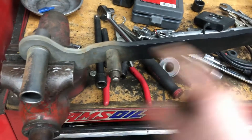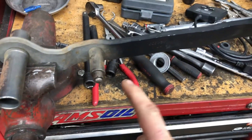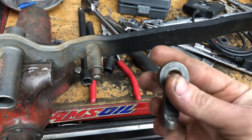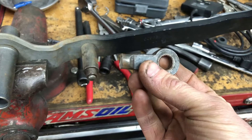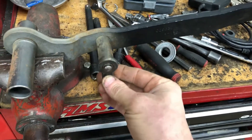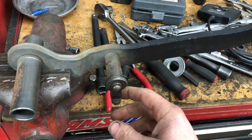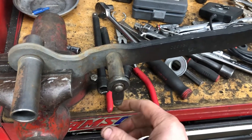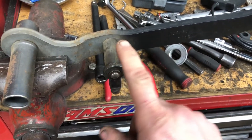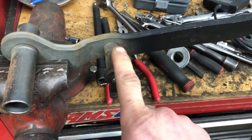This is the brake pedal assembly and the upper pivot — this is the pivot pin here. And this is the piece off the pedal rod that I cut off the vacuum booster. You can see that it fits on there; there's a clip that holds that. Normally you press this and push that rod into the vacuum booster to actuate the master cylinder.